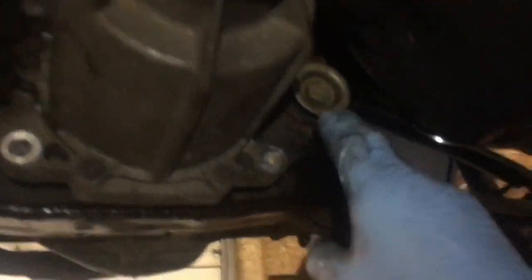So we pulled out our four 15-millimeter bolts here and our three back there on the brackets. We're gonna pull out these, I believe, 19 millimeters for the wings right here, so they're loose. You might not be able to get this one all the way out because of the gas tank, but that shouldn't really be a problem. And we're gonna pry out the lower control arms so everything's all loose and ready to come out. Okay, so the wing bolt was 21 millimeters.